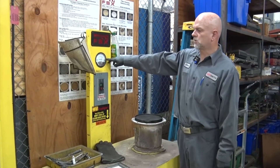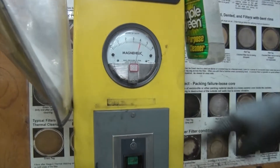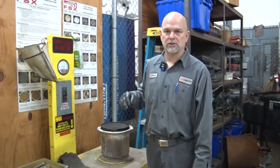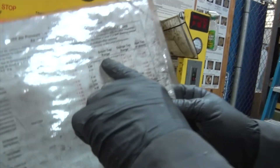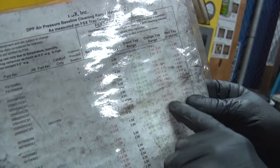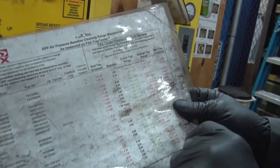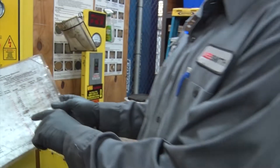Before it was 5.4, now it's down to 4.0 — that's after blowing it out for just a little bit over 30 minutes. I'll go in and check the specs to make sure it's in specs. You got a green tag range and an orange tag range. If it's in the orange tag range, you want to probably bake it and get it as clean as you can. If the spec is in the green tag range, that means it's ready to go — you're not going to clean it any better.